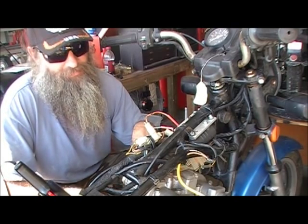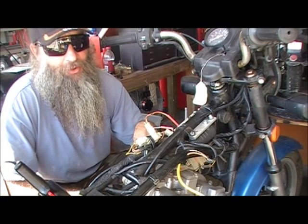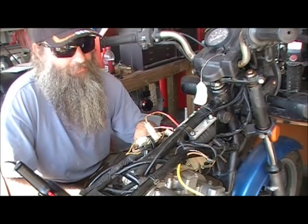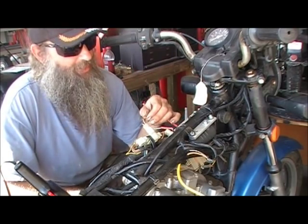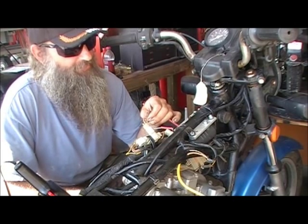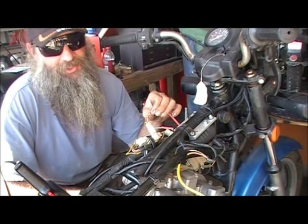Emgos — you've got that cold-start problem if the battery's a little low, but they're tolerable at least. The tech coils though — I can drop this battery down to ten volts, hit that starter button, and this bike's still gonna fire.